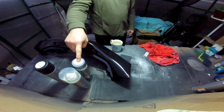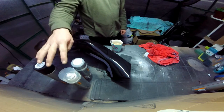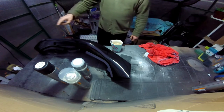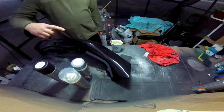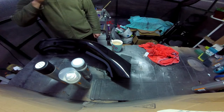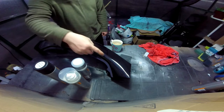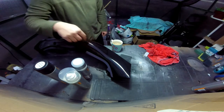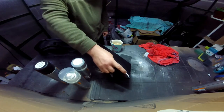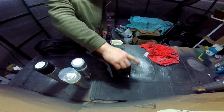It's one coat of aluminium, three coats of black, two coats of lacquer, if you can get away with two coats. If you haven't been confident and just had a bit of courage with the lacquer, it does take a bit of courage. You think, my goodness, this is going on thick. But you have to be kind of confident. Thick coats. First coat not so thick, second coat thicker. A good wet coat.